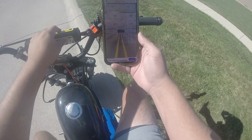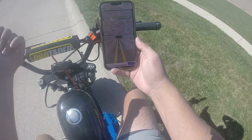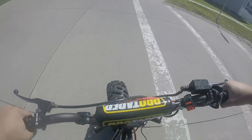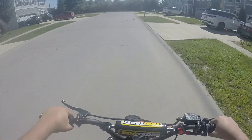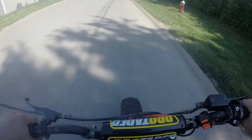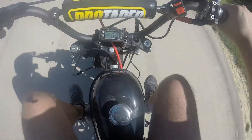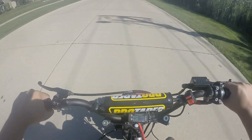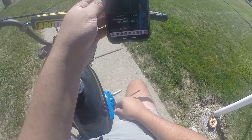I'm actually thinking I might have too big of a main jet in this thing. I'm going to drop a main jet because it seems like it's hitting too rich up top. So I'm going to drop a main jet and then we're going to come back and do a top speed run. All right, top speed run, 6.66 gear ratio — oh my God. 48.28!